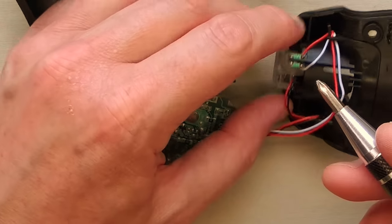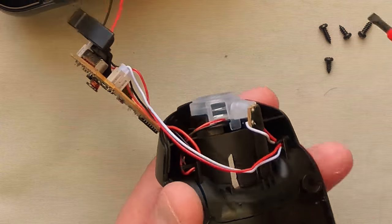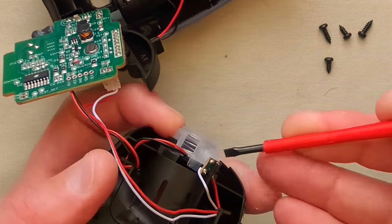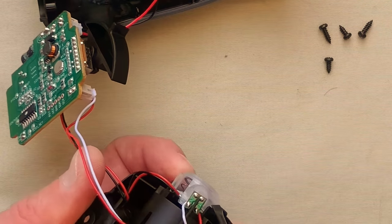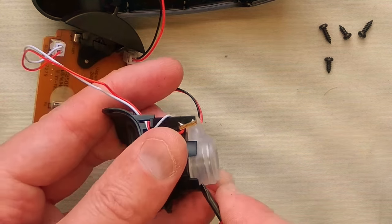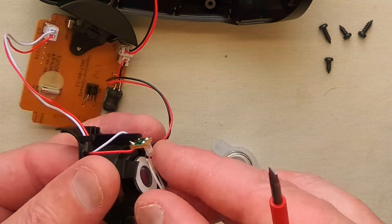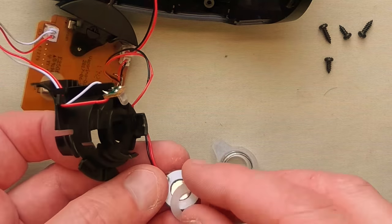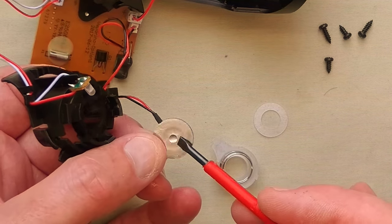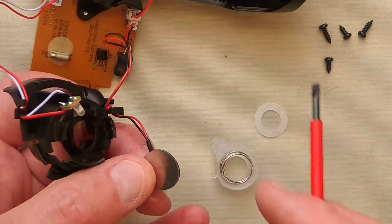So the atomizer itself — let's pop that out. The atomizer is actually based on a little ring. This is where it's very similar to Wisp — there used to be an air freshener, I think it was made by Glade, called Wisp, and it was the same sort of principle but much smaller. So if I pop this apart — yes, it is coming apart. That reveals a spring. When you put the aroma cartridge in, the wick pushes up against this ultrasonic disc. There's an insulator and a spring ring insulator. The ultrasonic disc has a metal disc, probably stainless steel. In the Wisp it had lots and lots of tiny holes, but this one I think might just have one — it's very hard to see. I should look at that with the microscope since I have one.